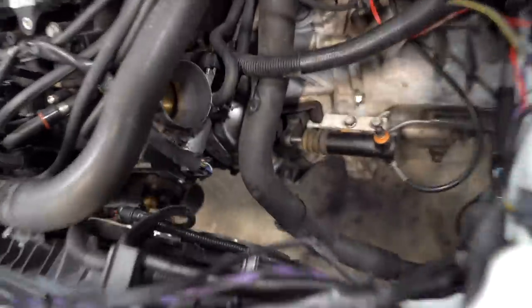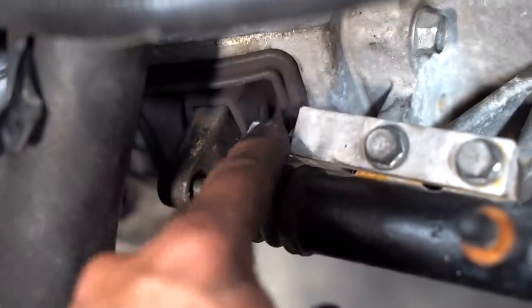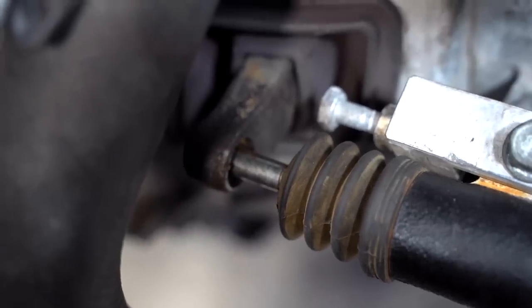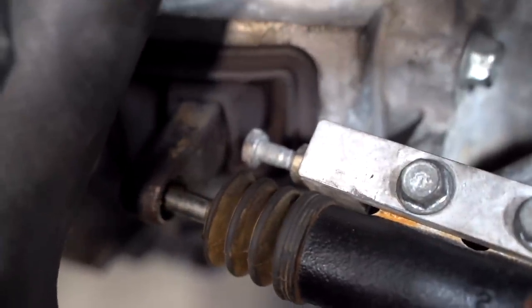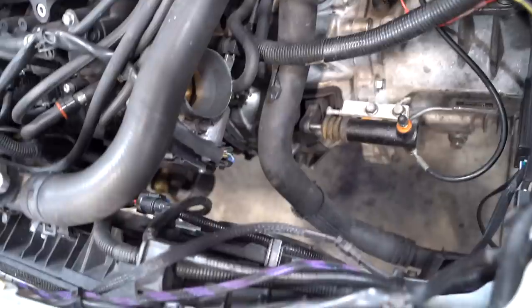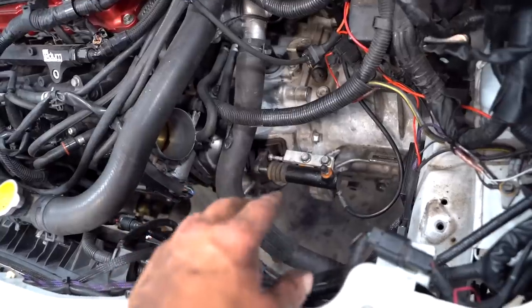That feels much better — of course the old clutch was completely destroyed. Here's something interesting: when a clutch wears, the fork pushes further and further toward the slave. This bracket makes sure the throw-out bearing never pops off the clip. You want very minimal space between the head of the bolt and the fork. With our old worn-out clutch it was adjusted properly, but look how big the gap is with the new clutch — that shows how worn our old clutch was. We need to loosen the lock nut and pull this guy out. There should be a little bit of a gap — maybe an eighth inch — because if it's completely touching you risk clutch slippage. These adjusters are very useful, especially for around $30.